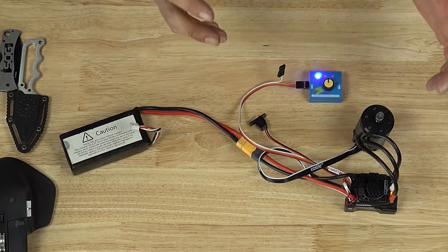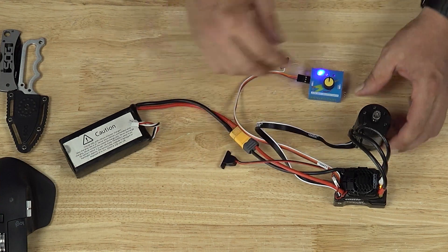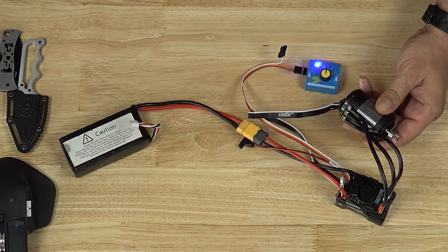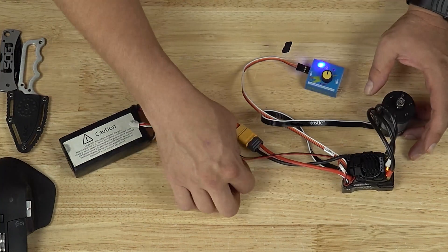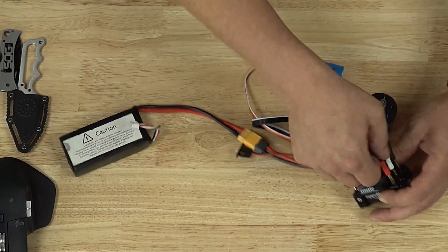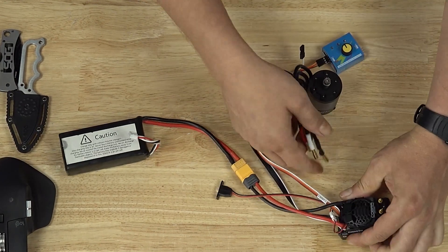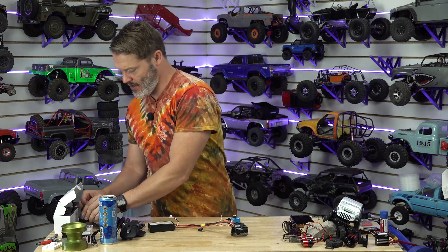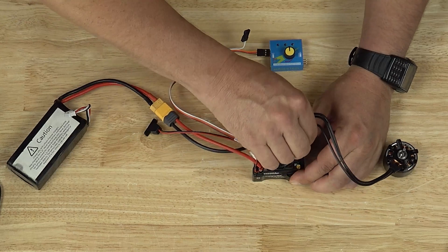For a crawler, this is going to be your standard Castle efficiency and standard Castle power. It also has your standard Castle noise, especially with an outrunner — though not really a lot of noise once bolted into a rig. Crisp throttle resolution, and from what I've tested, it has extremely good low speed control that you'd expect from Castle. I have heard reports that the Mamba X still has slightly better low speed control for crawlers, especially with larger, lower KV motors — something I haven't been able to personally experience yet.